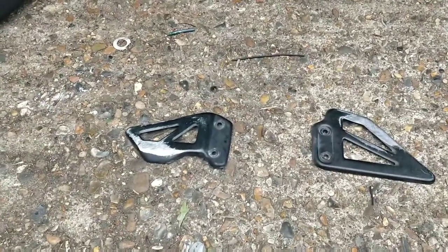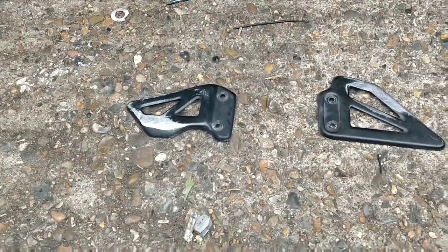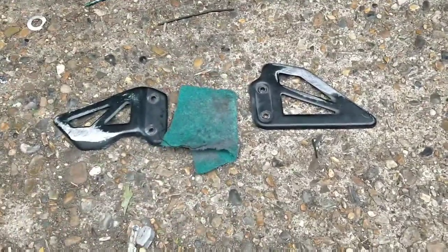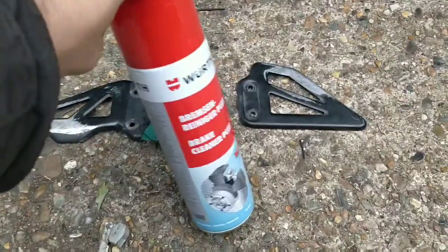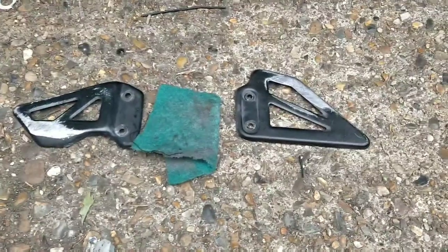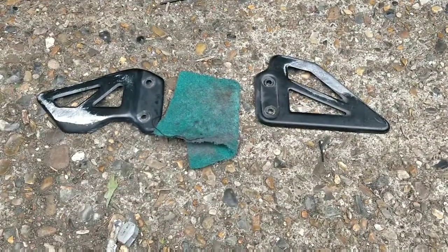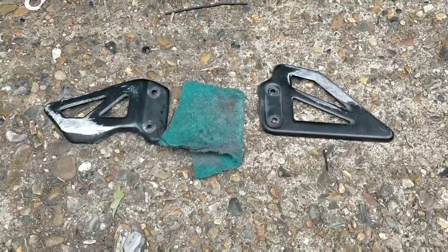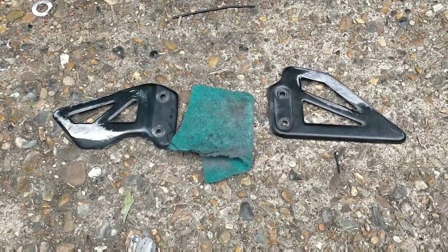So we've done quite a lot of spray painting stuff on my channel, so I'm not going to show you the exact, but it's the same system. Scotch pad it, scratch it up so it's not shiny anymore, clean it with the brake cleaner just before you spray, and then 3 light coats to make it sticky so that it attaches, and then 2 or 3 wet coats so they're thick but not thick enough to run. I'll show you once they're done.